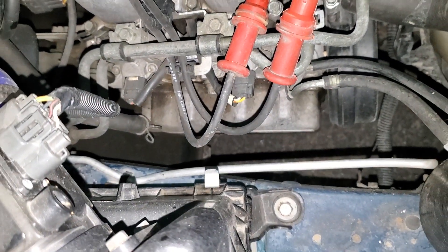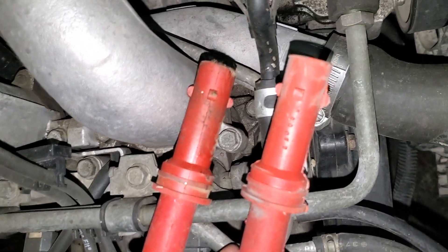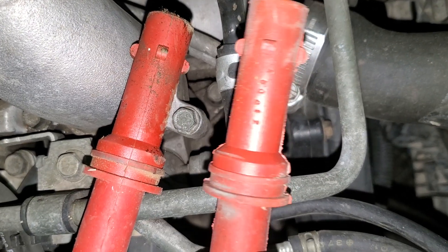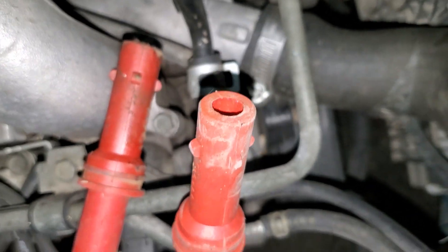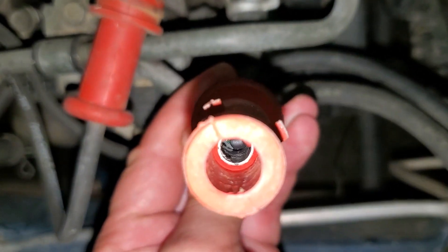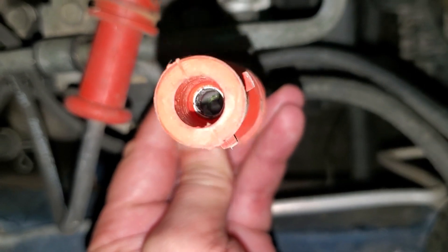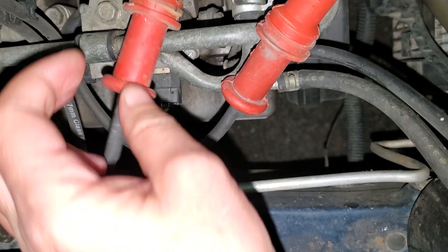These plugs are exactly how they go in. As I look at this one — nice and dry, a little bit of oil residue, more from the top it looks like, because the bottom is basically dry. When I look down in there, it looks like it's been maybe arcing out a little bit at the very bottom. Not black black, so it doesn't look too bad.